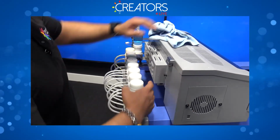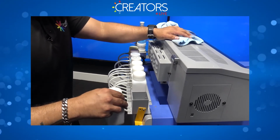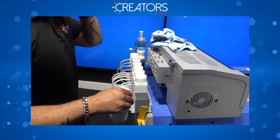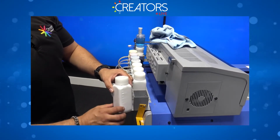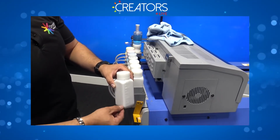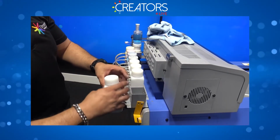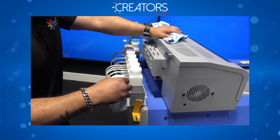So every time that you fill your bottles, don't forget, before you pour the fresh ink, make sure you pull them out and swirl them for a good 20, 30 seconds. The reason why is because the white ink tends to settle. Sometimes if you don't swirl for a long time, you're going to end up having a super thick settlement. You don't want to have that in your bottle, so make sure you swirl them a lot.